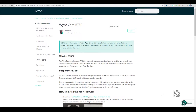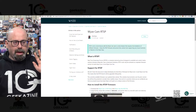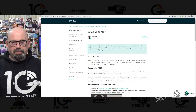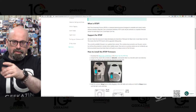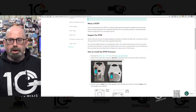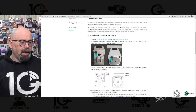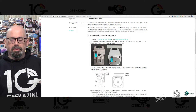So how do you set it up? It's very straightforward but RTSP doesn't come natively on the Wyze camera. You go to their website and search 'Wyze RTSP' — that brings you to the page. It's listed as beta, though I've read it may not be anymore; it's not fully supported, so if you have problems they may tell you to reset and start from scratch. They have two firmware types: one for static cameras and one for the Wyze Cam Pan.